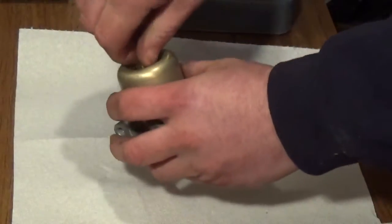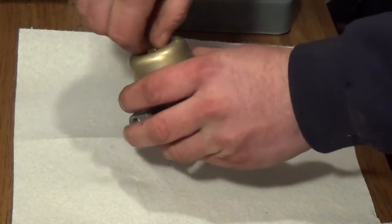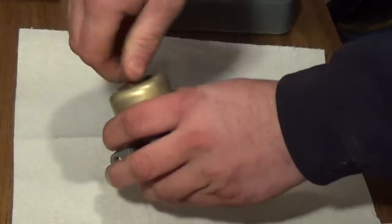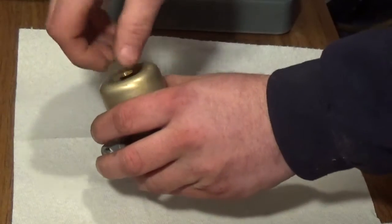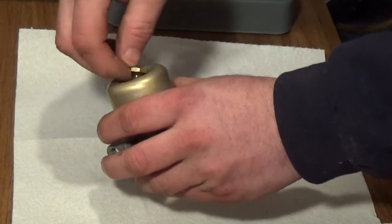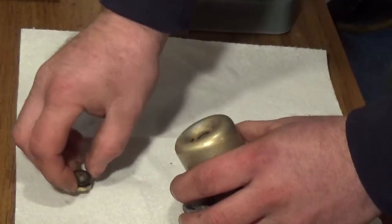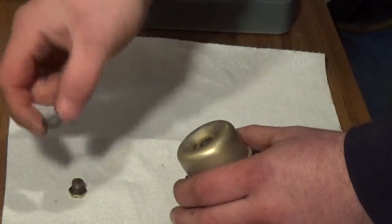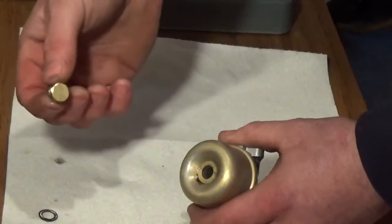Let's have a look at this. All this is is the effect of the ethanol on the carburetors — it just eats them up terribly anymore. Okay, this is a sealing washer. A lot of people have trouble identifying what this part is. It's called a sealing washer, and it's used for the bottom of the float bowl to seal this jet.